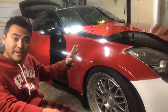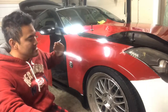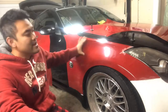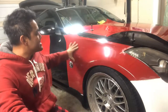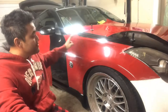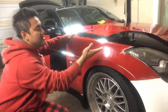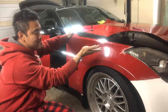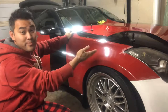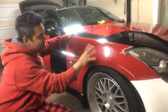The stock fender is actually quite easy if you plan it out right and set it up correctly. You'll notice it's not a very flat fender — it bows out. What you want to do is set all of this first in the general middle area, then use the body line as an anchor point. Pull really hard toward the front of the car and toward the back so that you get horizontal lines in your wrap.